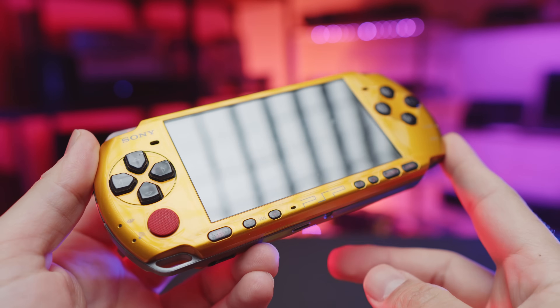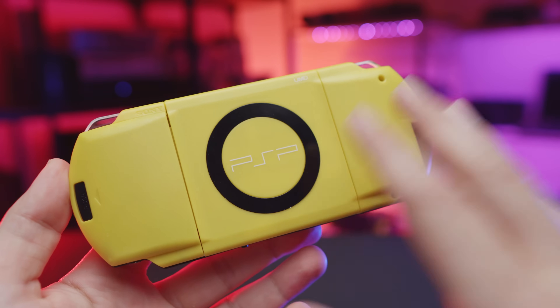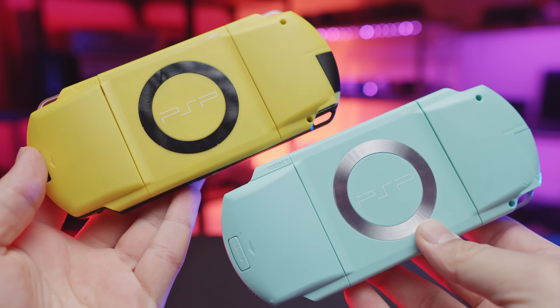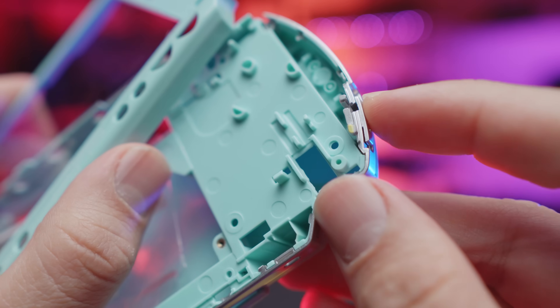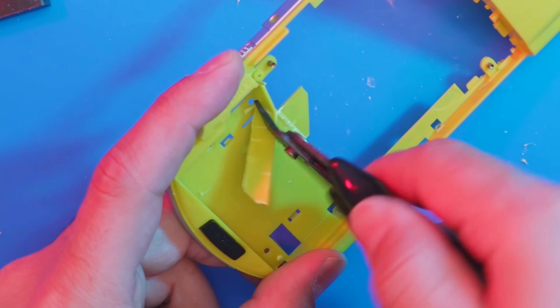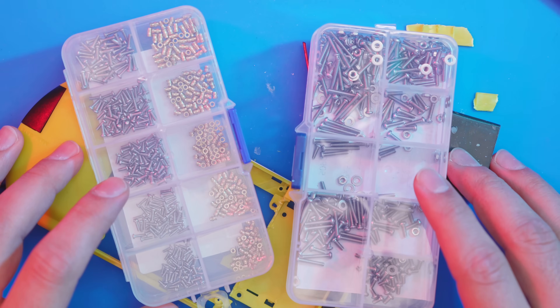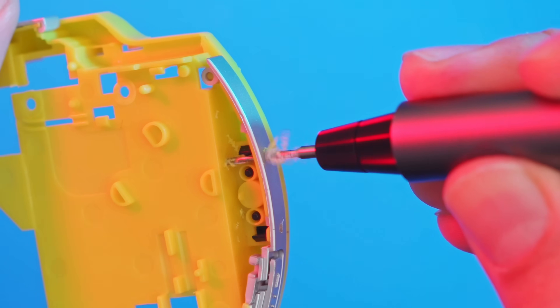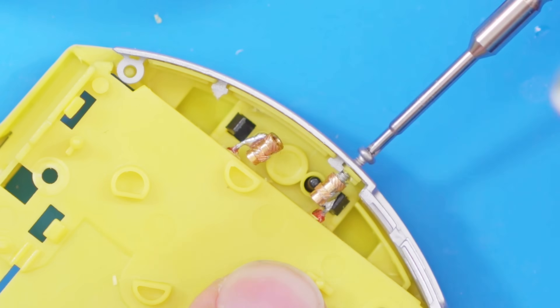Although I was going to use my slim model as it would be more impressive size-wise, I ended up going with the fat model so everything fits as comfortably as possible. I was initially worried about ruining the shell — one of the last good shells in the aftermarket space. These are the only two good 1000 shells left on the market, and you can identify them by the color and most importantly by using a single power switch — if it's split into two pieces, stay away. Then it was finally time for some chopping, hacking, snipping, and trimming in that area. Once done, I decided to use screws with brass inserts as the output leads, but the trickiest part was getting proper placement on the trim piece — the right distance, centered, and fitting well — and it went through a bunch of different revisions.